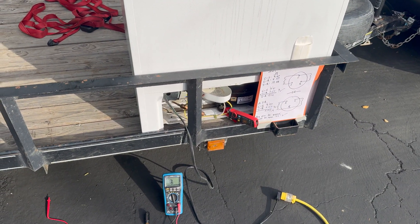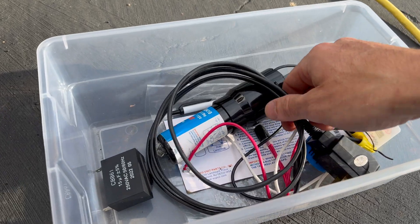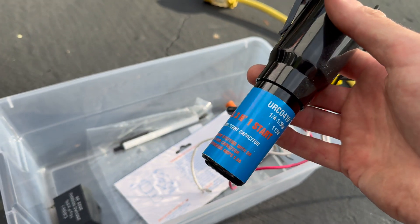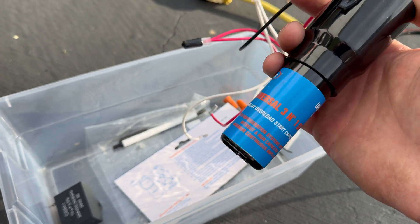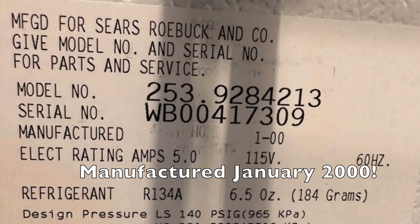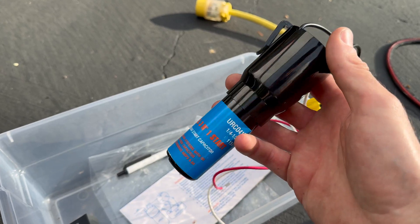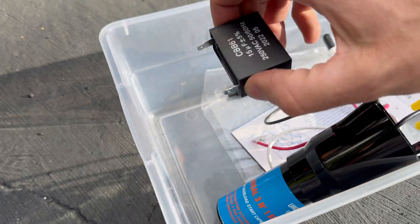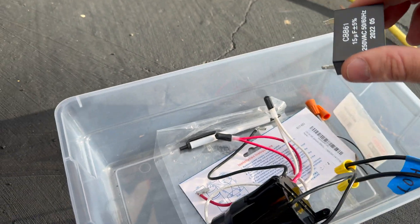That's a new development. Perhaps now is a good time to try this device — it's called a hard start kit. It functions as a troubleshooting tool but can also be an actual fix for older compressors that are having a hard time getting started, which is what I'm experiencing. It's essentially a large capacitor which helps on the starting winding.